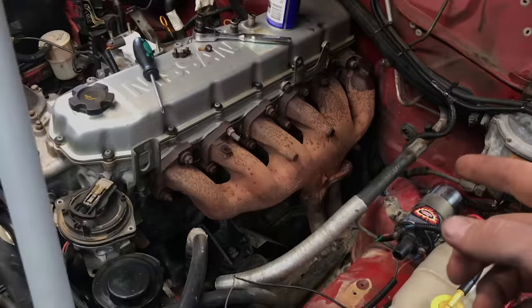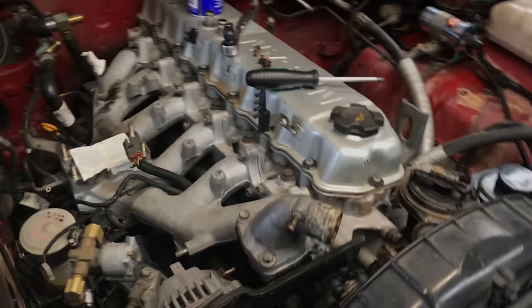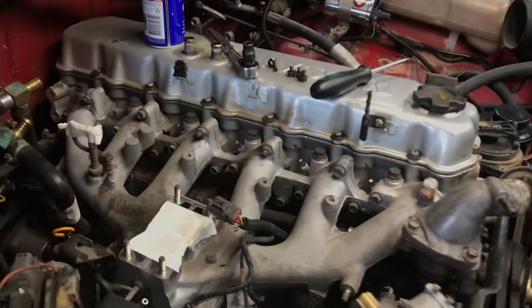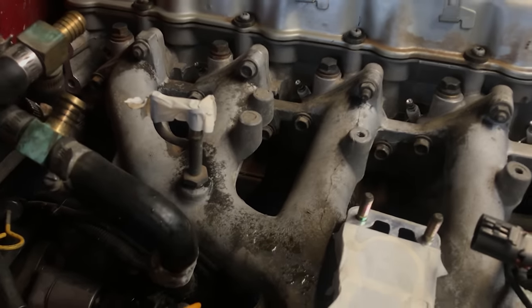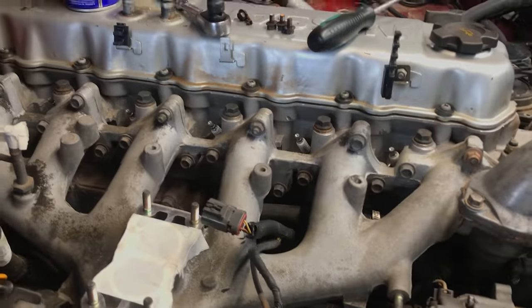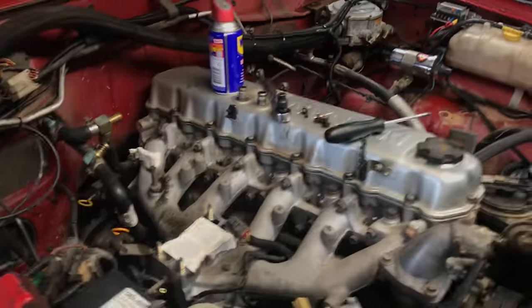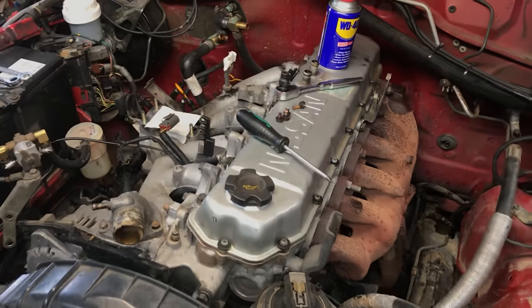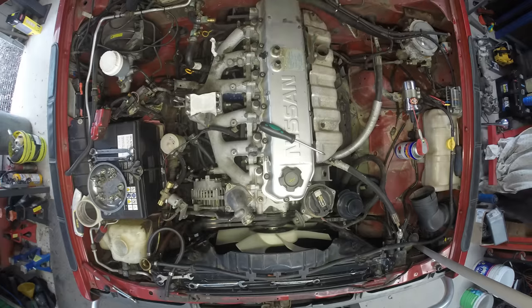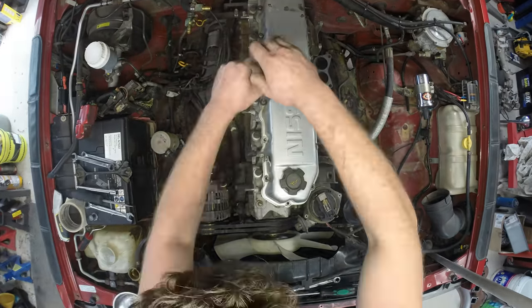Next is exhaust manifold — this is your best friend: WD-40 the hell out of everything on there. Then intake manifold, same deal. I've been cracking all the bolts by hand. You can use a gun to run them off, but I'd use a ratchet or a spanner to undo them to start with, just because they're going into an alloy head. Alloy tends to grab, and you will get them undone with a gun, but there's a chance you might rip the thread out, which makes your day a lot harder. So we try and avoid that.